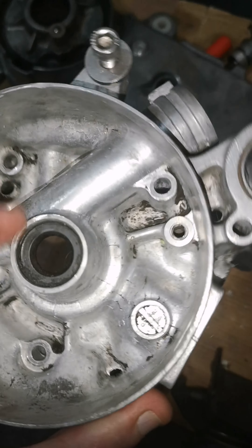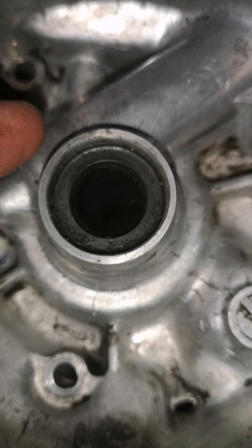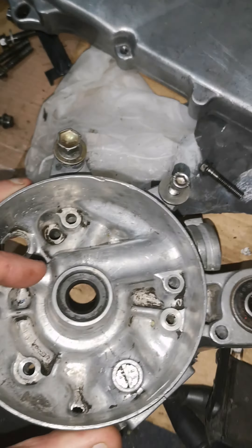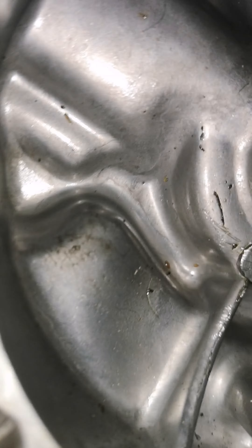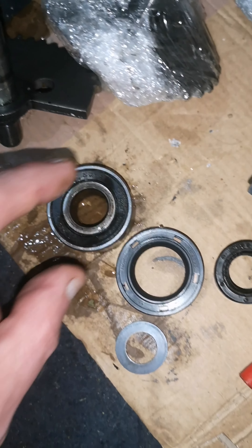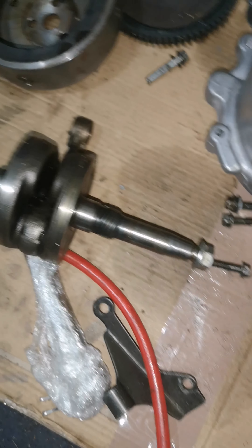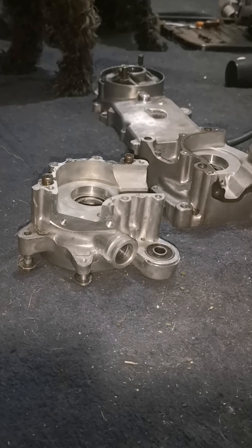This is the next video and I'll be putting the main bearings in. I'll just let that crank seal in just to see how far it goes when I watch the video back. There's the other crank seal - the main bearings out. That crank seal just sits flush with the casing. I've got the big bearing out the back. In the last video I thought this was another seal but it's part of the bearing. I've ordered that bearing, that seal, and the kickstart seal which goes in the other casing upstairs. So I'm going to put the bearings in the freezer for an hour now.